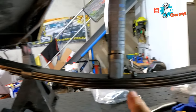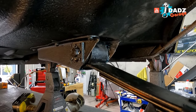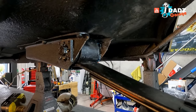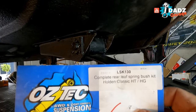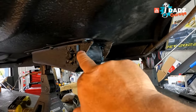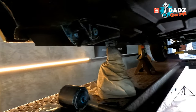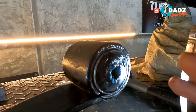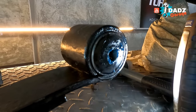Getting the bush in was pretty easy but trying to get it back in the hanger has been a pain. Fitted one leaf spring - pain in the ass trying to reseat it back in the hanger, that was an hour or so of hammer and wood block. The reason is this style of bush - you don't need to press it into the leaf spring but it just spreads. Went to Rare Spares and picked up the style that came out - it has a metal sleeve around the outside, you just press that in using a vice and a bit of grease.